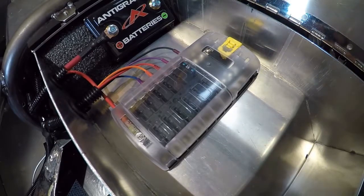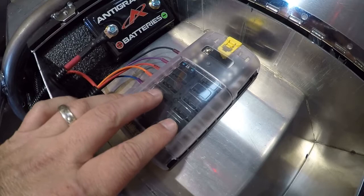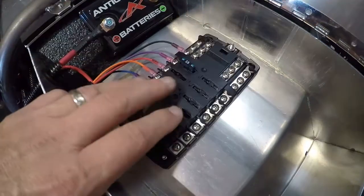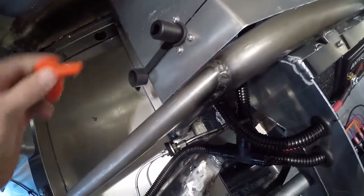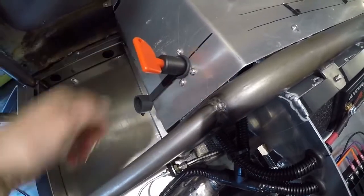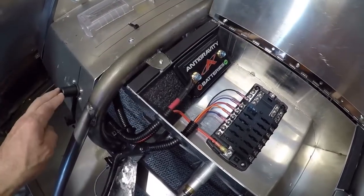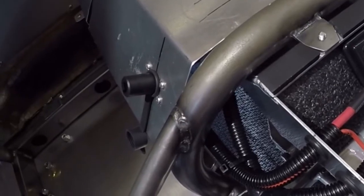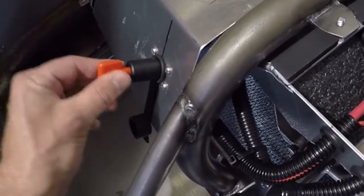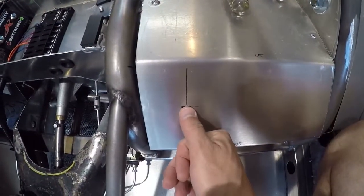This is the fuse distribution block that I bought off Amazon — I'll put a link in the description. I looked at a lot of options and reviews, and I'm really happy with this one. I've got it mounted in what I'm calling the distribution panel. The battery goes to this disconnect switch — right now it's off, turning it on energizes the battery to this distribution block. Opening this switch completely isolates the battery; there's nothing connected to the battery at that point. All distribution points come off the second leg of this switch, so in an emergency or short circuit, opening this will completely disconnect the battery.